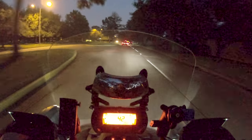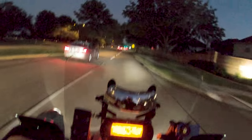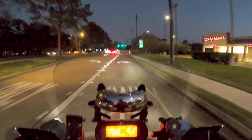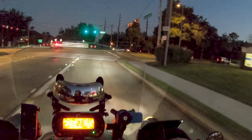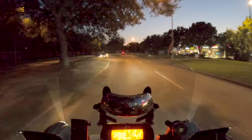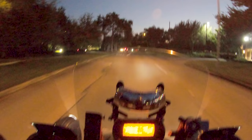Roast it. Ah, rubber. And of course I've got this thing aired up, you know, 6 or 8 pounds above what Can-Am says. I think it was 28 for the rear. I've got it sitting at 36 right now, so it's probably a little hard. Won't get quite as much traction as it should. Hey, sit there, buddy. A little less air pressure in it, it'll probably grip better.